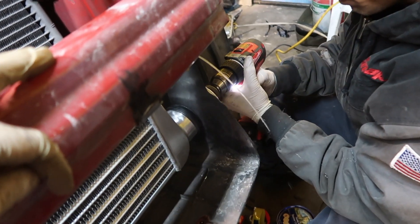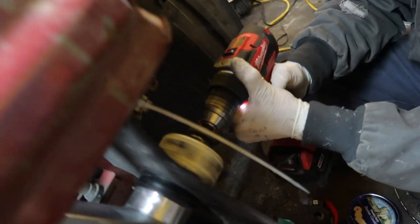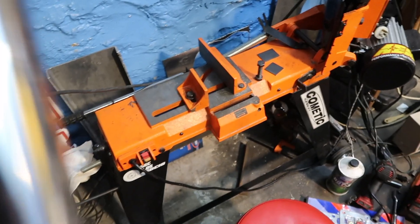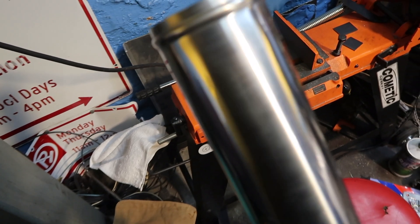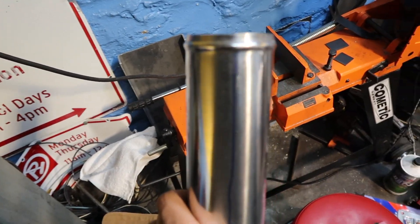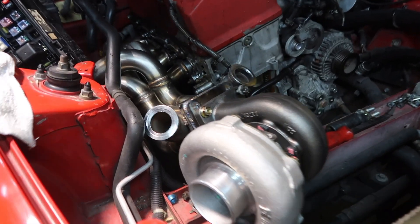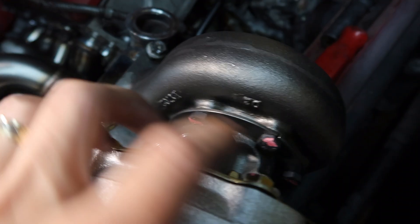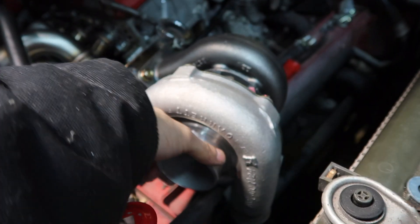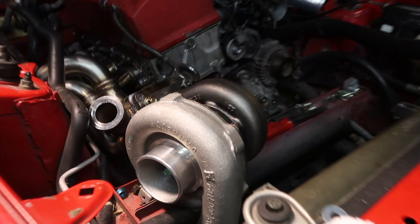Now we're cutting the plastic with a hole saw just to open it up, and the cooler is on. Right now we're gonna start cutting some pies. We already got it marked - one side and then the other side. Little update: manifold is on, turbo is mounted, we just clocked it so the turbo feed is up and the return is facing down. We still left this loose because we want it to have some play so we know where to run the piping and won't have to adjust it twice.